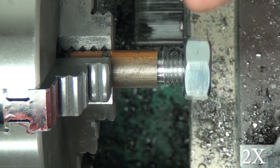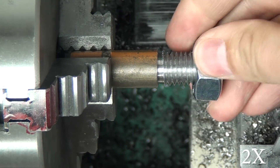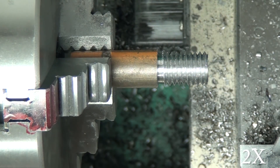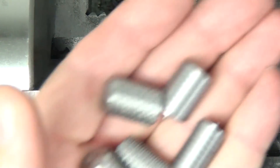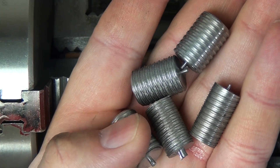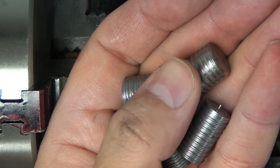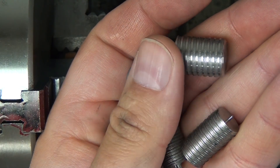I've cut the thread down to a 9/16 by 12. You can see how loose it is — it's dimensionally wrong — but the threads look really good. As evidence, here are some thread attempts I did before hooking up the second sensor. You can see there are multiple starts because LinuxCNC lost track of where it should be during the threading operation.